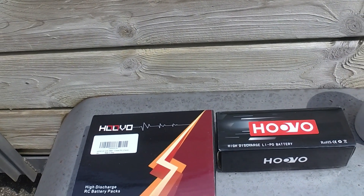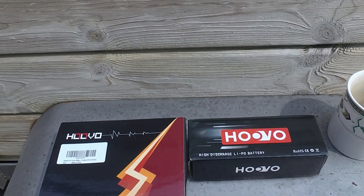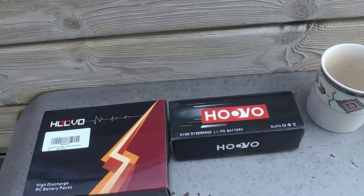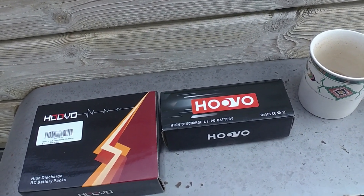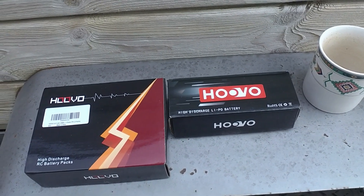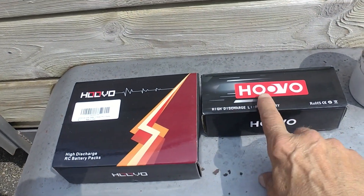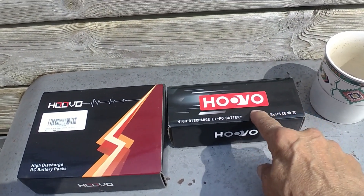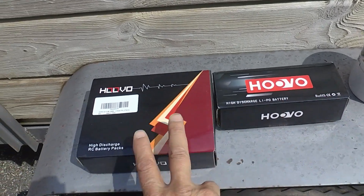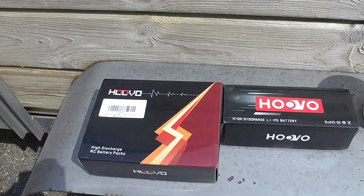They only take about two-thirds capacity. I thought maybe one battery might be a little old, so we cycled them all about three times. I flew the 3S batteries in a couple of planes and only got about two minutes of flight on something that ordinarily with a 2200 gets about three or four minutes easily and comes down with a 3.8 or better per cell. These flew for two minutes on the Timber and after two minutes they were down to 3.69 — almost stone-cold dead.